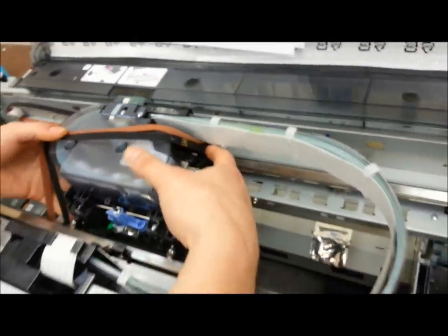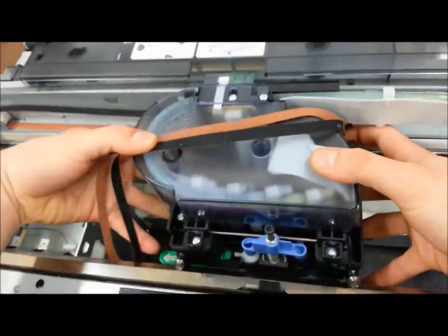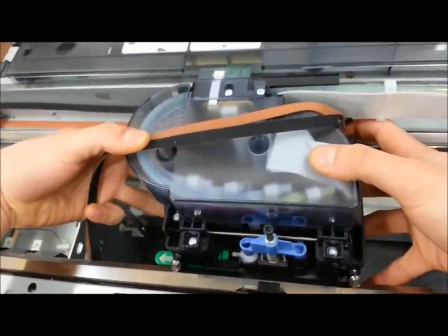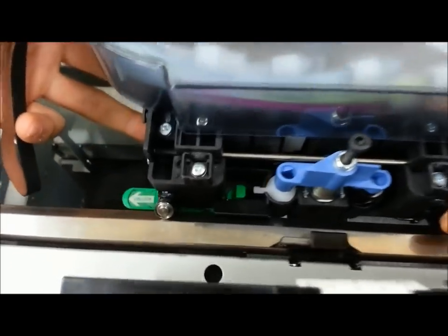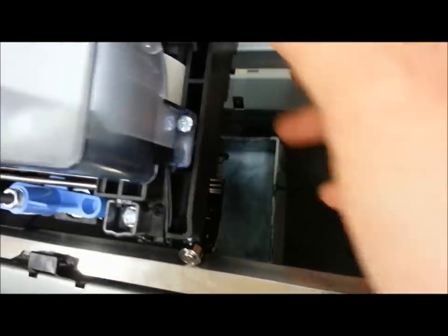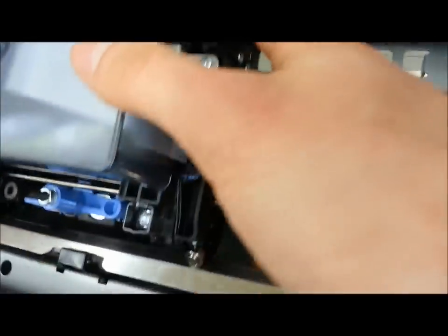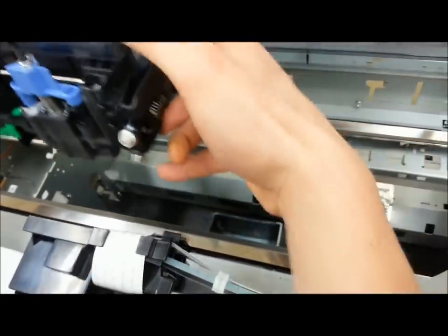Next, just watch the video — you're going to grab the printhead and carriage unit just as you see, and you're going to push it towards you. The wheel bearings closest to you are set through springs, so there is a spring action to it — you can kind of push it towards you and then pull out. As you can see, it comes out nice and easy.